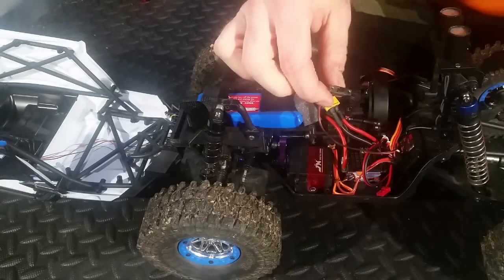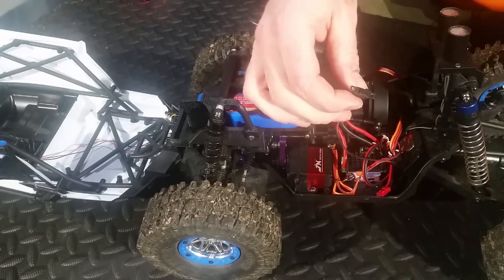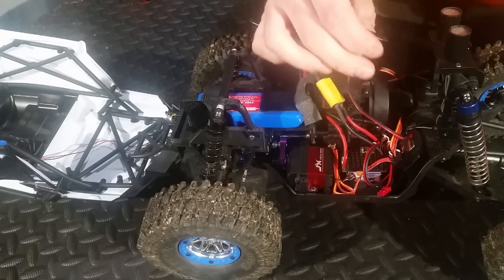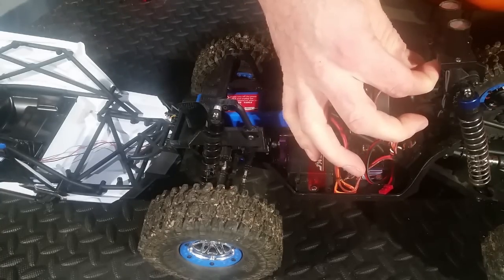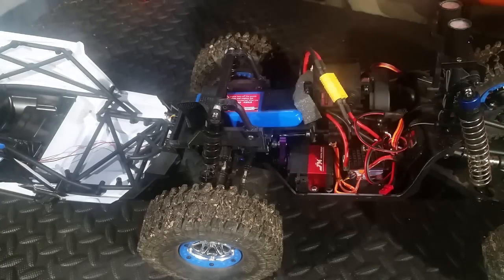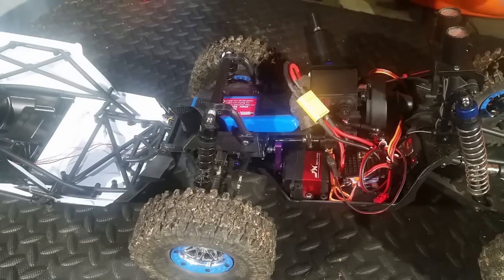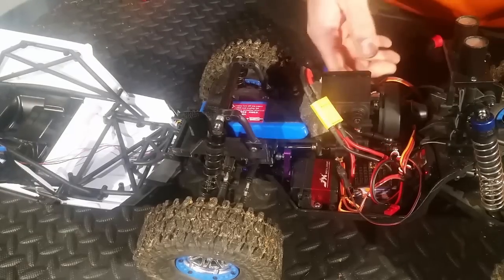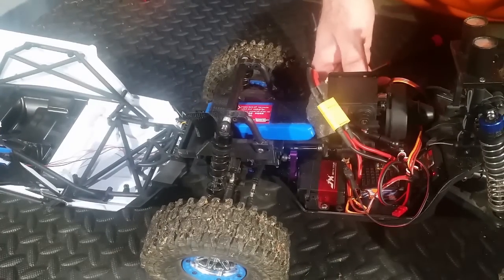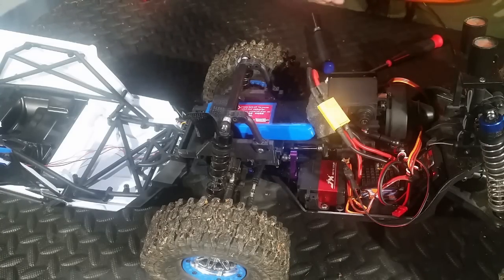When I install my battery, I've just got a little piece of foam that I use here to make sure that we don't have any issues between the battery and that mount. The only thing I have left to do is to mount this switch. This switch is a tiny little piece of junk instead of something more substantial, so I can't just tape it down. I think I'm going to end up notching the top of this plate so that this can slide right in. One thing I wanted to point out is setting your end points on channel three — it doesn't take a lot of throw. My end points are only set to about 5%. When I push the button you can see we're in first gear, there's second gear, and there's first gear. It doesn't take a lot of throw and there's no buzzing from the servo — everything's pretty happy.